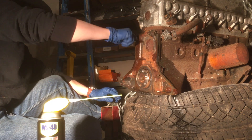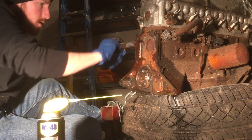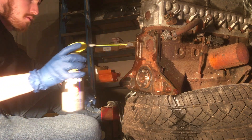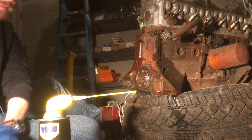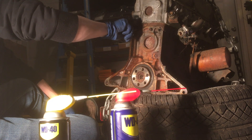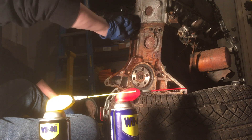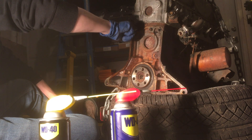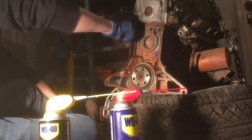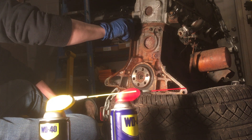Your goal should be to try to feed it in by hand as much as possible. You should only consider taking the wrench out if you follow a certain procedure - only small movements with the wrench. What you're waiting to feel is a little bit of resistance; you make small movements on the wrench to the point where it gets a little bit easier and then actually becomes light again. What's happening is whatever is blocking your path gets moved into that cavity we created in the bolt and is out of the way, getting easier to turn again until you encounter the next bit of dirt until you get to the end of the bolt hole.